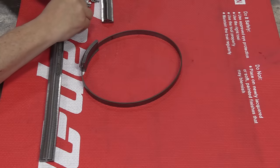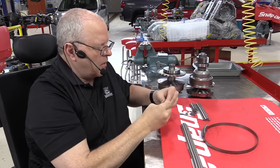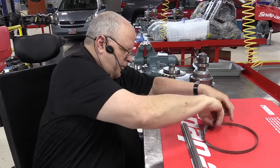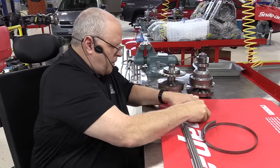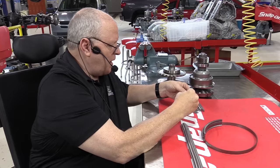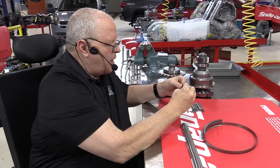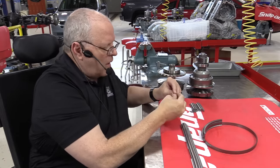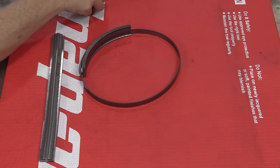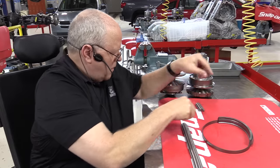These are directional, so you have to make sure they're all facing the same direction. That's quite easy because they have a bump on the end of each element that aligns them. They need to be very clean — you don't want any dirt or dust interfering with the fit. These elements are tapered a little bit so they can also turn the corner, or go around the pulley as an arc.